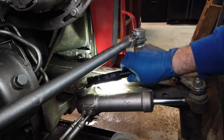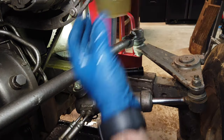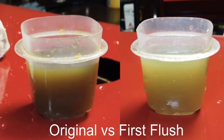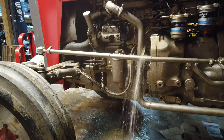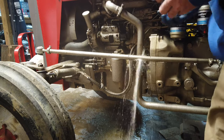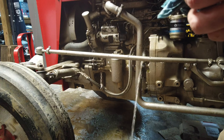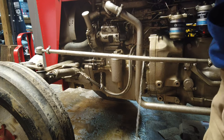Let's see where we're at on the second drain — this is after one flush. I'll probably do a screen capture and set it next to the one from before so you can see the difference. This drain plug was clogged up also, so I very gently tapped it until it broke loose. The coolant had definitely gelled up around the side of the block and in the main drain, so it's good we got both cleaned out. Don't forget about the drain plug on this side of the engine.